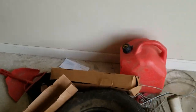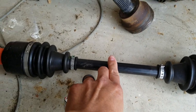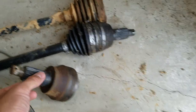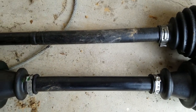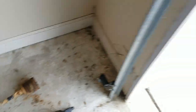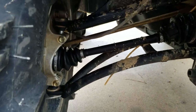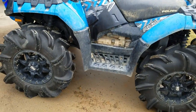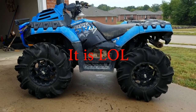On the High Lifter, we ordered East Lake axles due to several people's suggestion. We've got two of them for the back. Here's the stock axle and here's East Lake — they're close. In the back it works fine, but in the front we had to take the lift off temporarily because at full extension it was binding up. We didn't want to break another axle, so we took the keys off the front.